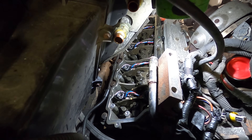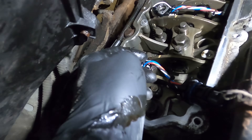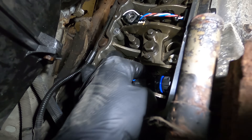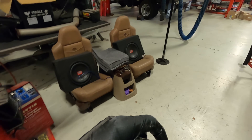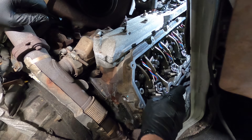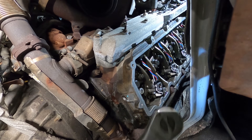I had to work the injector with my thumb — it wasn't sitting down in its bore all the way, so I had to give it a little nudge. Got the injector in, just need to get the electrical connector up through there. Look for the flats, orientate it — got it. Now, the book says not to use any power tools. It really is all about how well you know your tool and how many times you've done this. When you do something repetitive every day you're going to know the feel.